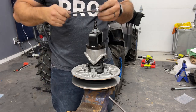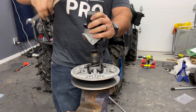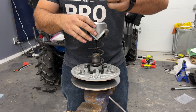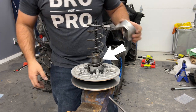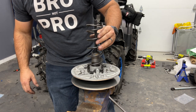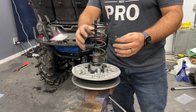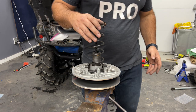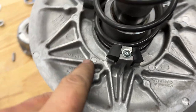Now we're going to jump over to the tool that goes into your vise — just going to set the secondary clutch down on here. The first thing we've got to do is compress it, then get the lock ring out. So now we're going to start compressing that spring down a little bit. That's the lock ring, and you can see there's a little bit of a gap in there now — that's what we're doing, compressing the spring down. Take your lock ring pliers, get them in there. Now we'll loosen this up and the spring will decompress. That spring was caught up on something. We don't want to lose the lock ring, and there's also what I think they call a keyway in here — that already popped off, so I need to look for it. It was just sitting down in the bottom of the clutch.